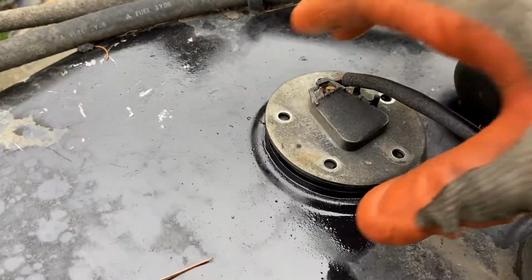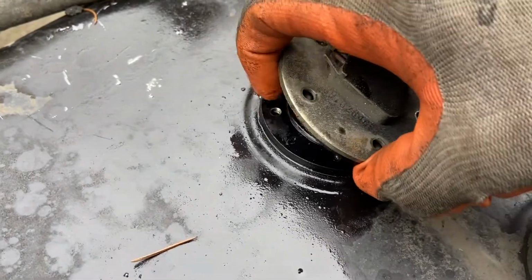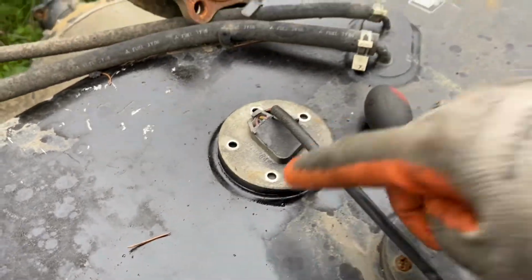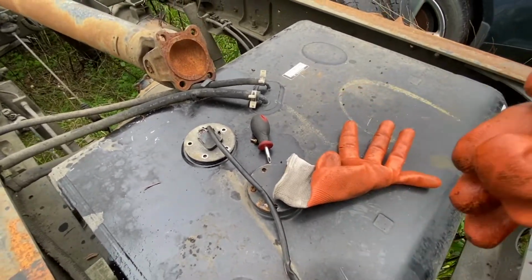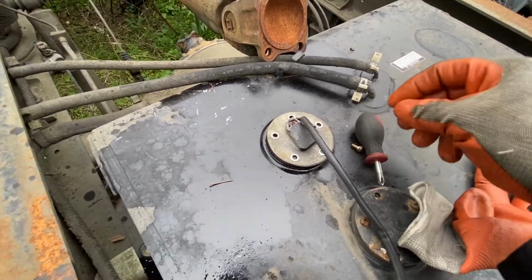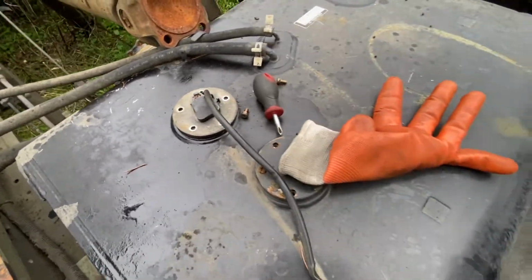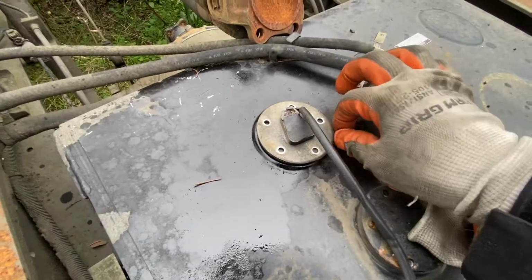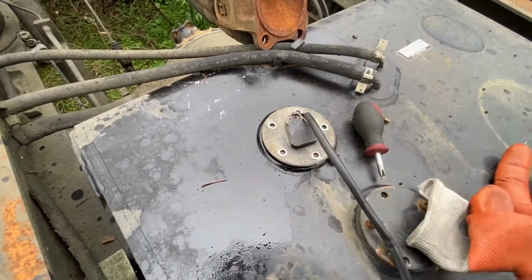Also, before you put it in, sometimes this rubber gasket that's right there doesn't match up. It will be hard, especially if you have something in the way, you won't be able to see it. So the best way to do it is, before you put it in, put the gasket on first, and just insert the screws so they fit in all the holes. Sometimes you have to stretch it left or right, because if you don't do that and try to put screws in, it's not lined up. It'll be hard to line it up. Make sure you line it up when this thing is out. And then you put the screws in, and the rubber gasket will kind of hold them. And once you put it in, line it up, then you screw it in.